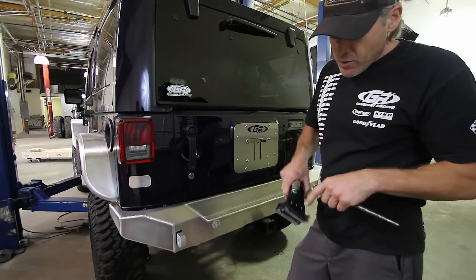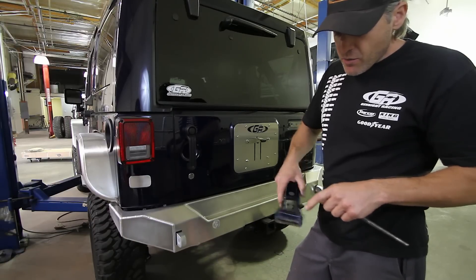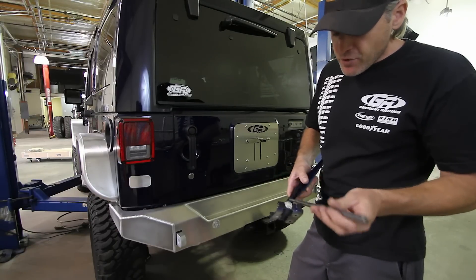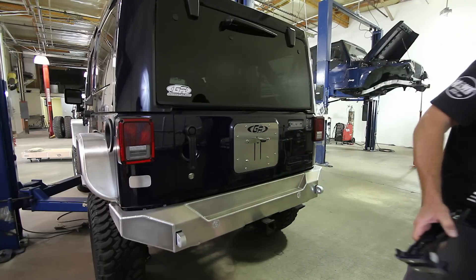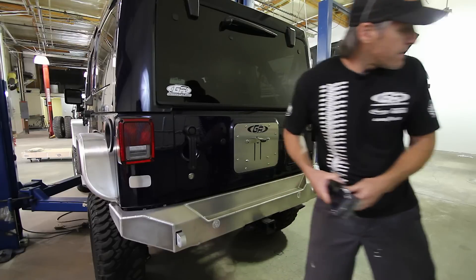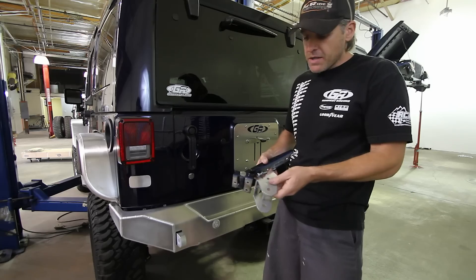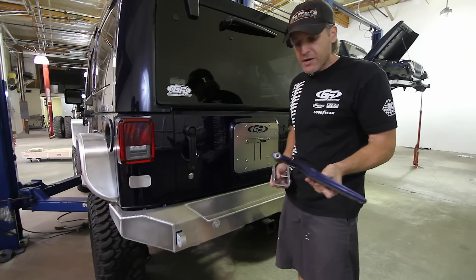As you can see, we've ground the top piece of the rivet off. Take a drift punch, support this in a vise, and beat the rivet through. What we replace it with is the pin that comes in the kit. Once the factory pin is knocked out and the new bracket is installed, we'll move on.